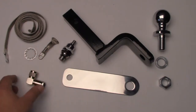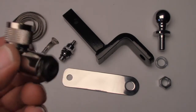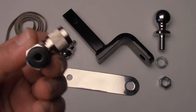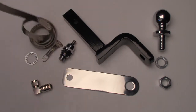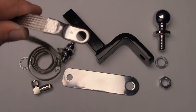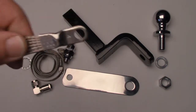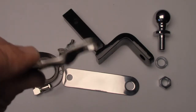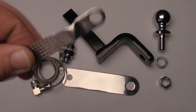And I decided to go with a 90-degree 259 connector. Install a little grommet under here. I'm going to probably use RG8X cable. So I think it'll be fine. And then I decided to use 1/2-inch, probably copper tin plated ground wire, 1/2-inch wide, with a number 4 terminal. Can you see the 4 in there? There it is, number 4 terminal connector that I crimped in a vise. Stuck it in there as far as it would go and crimped it down. Made a nice mechanical connection.